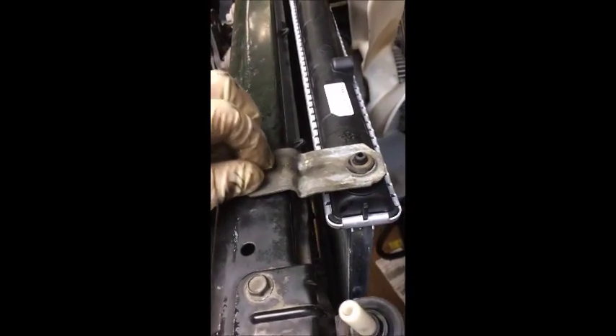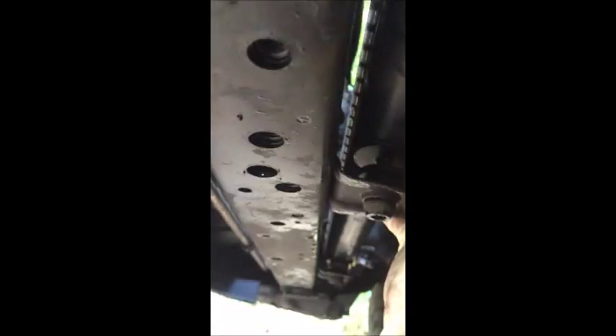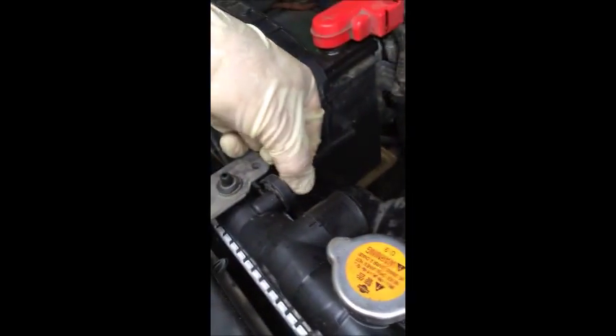When I took it out I took the fan shroud out first and then the radiator, but the radiator is very secure at this point. We'll have to connect the upper radiator hose and tighten the nuts — one there, one here — and the lower hose from the thermostat housing down below, and one hose up here. Make sure the radiator goes where it's supposed to go. The radiator is in place; it fits right in here. The plastic cover or shroud has two 10mm bolts on top of the radiator, one on each side, and the radiator cover is done.